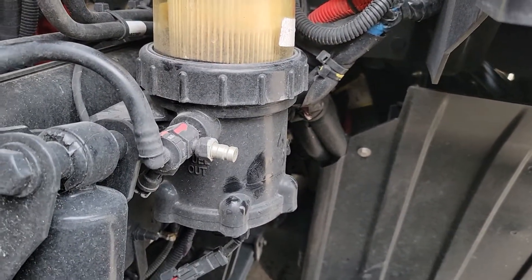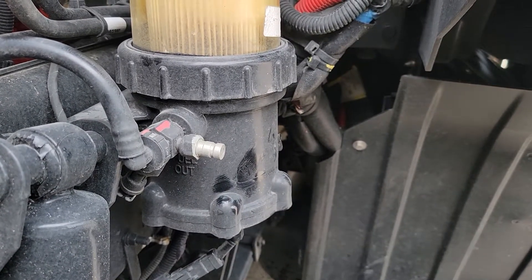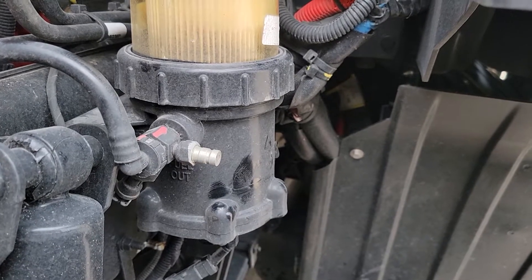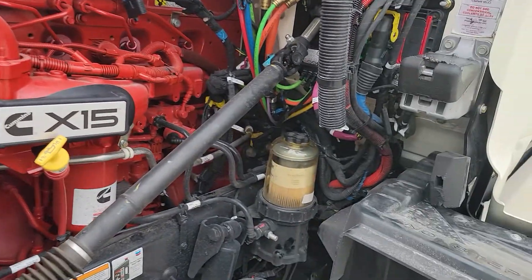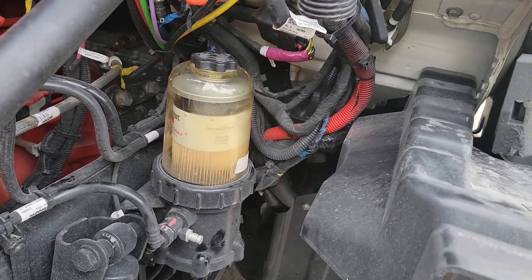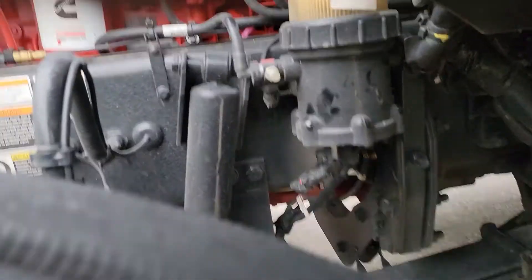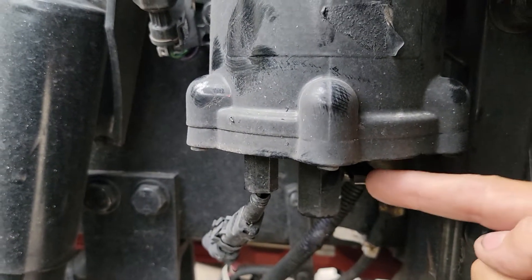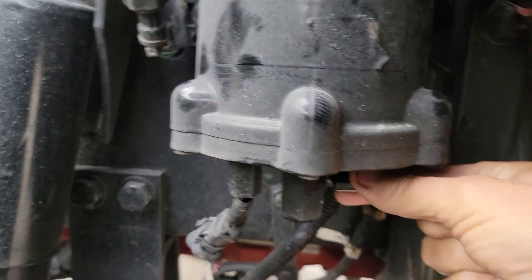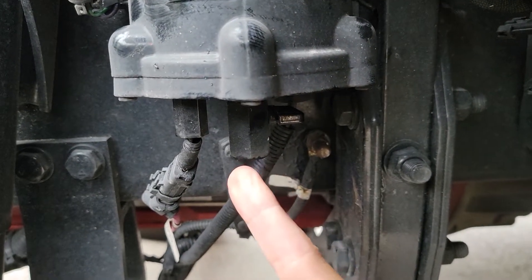That's it — hopefully this is as simple a video as it can be. Sometimes you don't have to drain it for a long time, and then sometimes you just have to. Right now it's November and I'm in Dallas. I've only got about 4,000 miles on this X15 Cummins and I already had a little bit of water in my fuel filter. Let me go underneath and show you — it's a real easy little lever, just right there, grab it and twist it to the left. That's mostly fuel coming out but it just comes right out the middle.